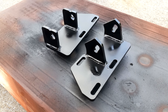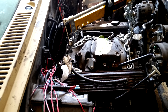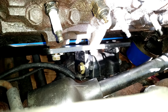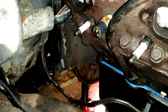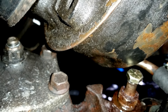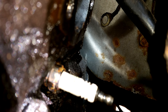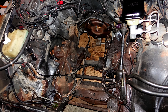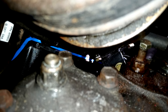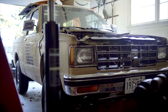I cut them shorter and notched the mount holes. Now it's in, actually sitting from the motor mounts, but it's sitting a little far forward — the radiator is not going to fit. At least the mounts line up. But a new problem arises: it's too close to everything. The power steering pump is just about touching the gearbox, the oil filter is actually over top of the diff, and the block is hitting the firewall. Some of these problems could be solved with shorter engine mounts, but then the oil filter is hitting the diff, and I'm worried about the oil pan hitting the diff too. That power steering pump and those power steering lines are not going to work. So if I'm set with this position and I don't want to hack a big chunk out of the firewall, what else could I do?